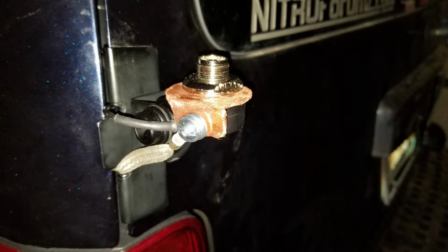Folks, I just wanted to touch on something briefly. One of the issues people have had with the ATAS and these types of antennas over the years is they end up without having proper bonding and grounding. And if you don't get really good bonding and grounding, the radio is not going to be able to work the antenna correctly. So far mine's working pretty well. I think I've done a reasonably good job, but you really want to pay some attention to that so you can get functionality out of the antenna the way you would expect.